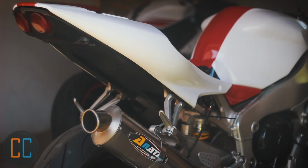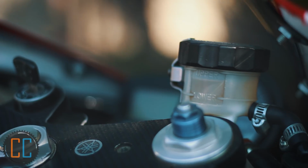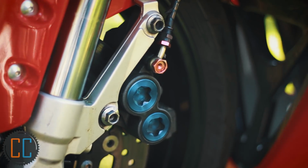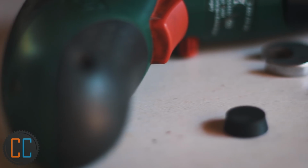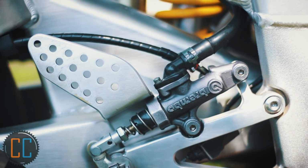However, with the bike fired up again, we finally got to hear its sweet sounds and see the odd flame. But the dream of riding the bike quickly ground to a halt when the brake calipers got a rebuild and some fresh fluid. But once put back on the bike, they wouldn't build pressure. After weeks wasted, we discovered that the master cylinder seals had perished and that it would take a month for Yamaha to get the seals from Japan. With our impatience growing, we had similar seals cut that did the trick, and needless to say, the Yamaha seals still haven't arrived.